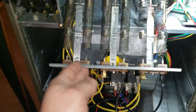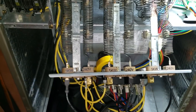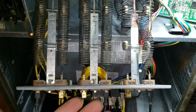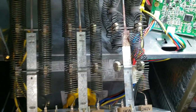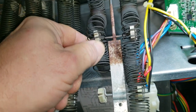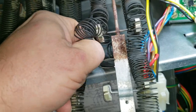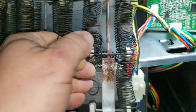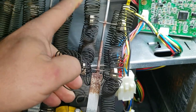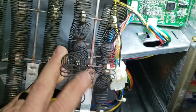The way it's wired up, it's one strip for low, and then the outside two are your high — which they're technically calling medium. I didn't have any tripped breakers or anything else. But once I pulled out the electric strips, I wanted to point something out — as you can see, they broke and they've literally welded themselves to it. The reason why it didn't trip the breaker is because this is a resistive short to ground, in all reality.